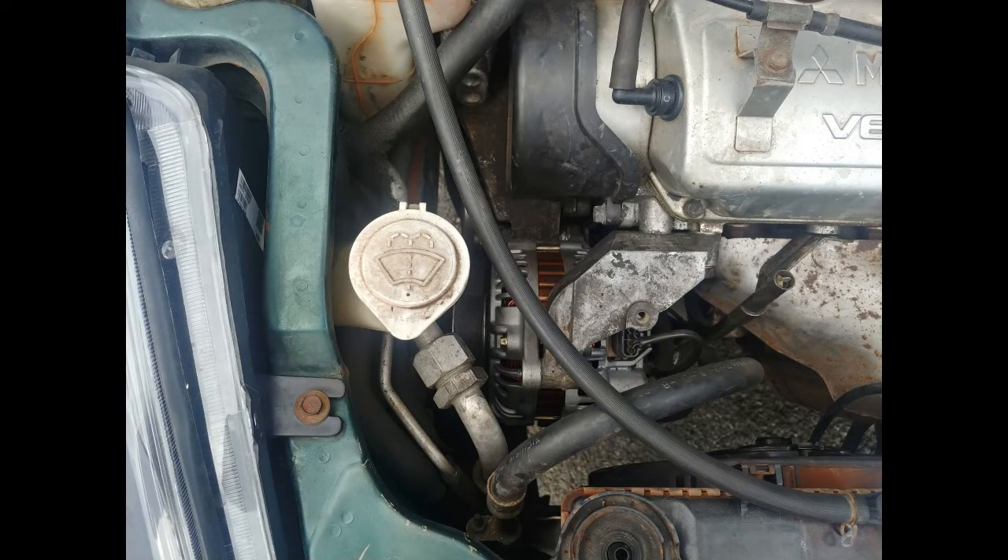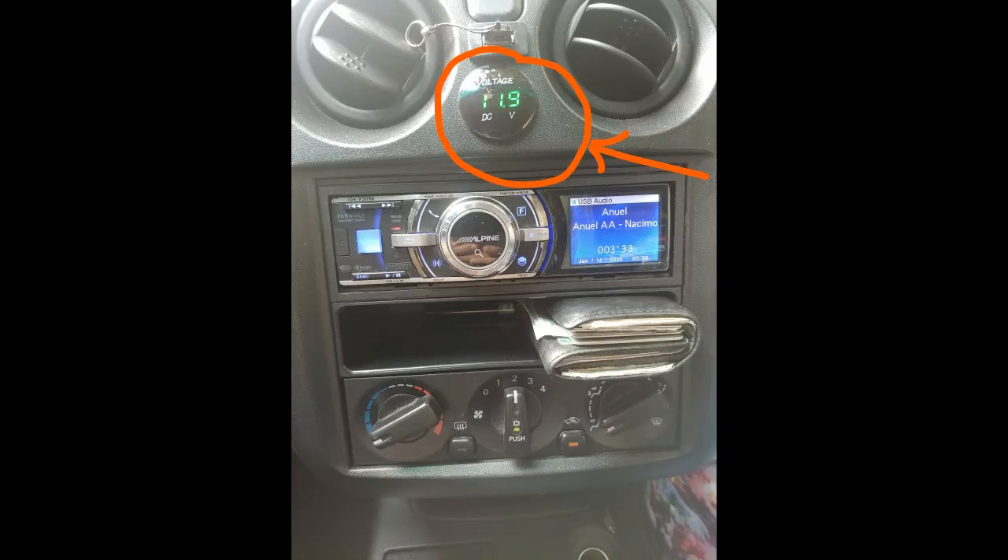For the immediate update: the problem with the voltage regulator was that once it was running, the alternator itself was running fine. But once I would go into like a half-hour drive, the alternator would just fluctuate voltages — for example, it'd be running at 13.9, then all of a sudden, even with accessories on like AC, wipers, and lights, voltage would drop all the way down to 11.9, yet it's still charging with no warning light coming on. To make a long story short, I removed it and ended up buying a stock alternator.